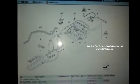And that is actually the pyrotechnic portion of that positive cable. It's going to come all in one piece. So what you need to do is remove the battery completely, which I have the video for. And down on the inside panel in that well, you're going to have a cap. And that cap is going to hold the nut, and then the bolt side is on the vehicle side. I believe it goes towards the wheel well area.